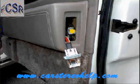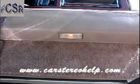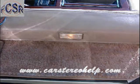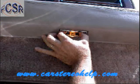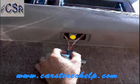Disconnect the connector and remove the one exposed screw. Along the bottom of the armrest is one courtesy light — pry the white cover off, squeeze the two tabs in, and pull this courtesy light assembly from the door panel, releasing the connector and removing the exposed screw.